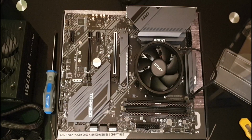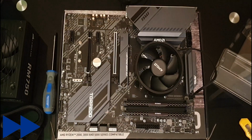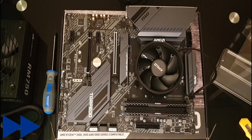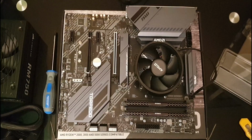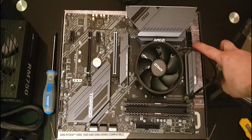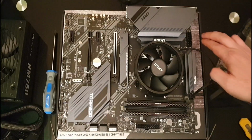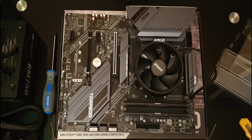We have to get power to the motherboard. So I have a modular power supply for this. So things to remember here. This is your 24-pin motherboard. Here is your 8-pin CPU, and I also have a +4 CPU in this because this motherboard is overclockable. If you have the 8 and the 4, you don't have to fill all 8 and 4. I'm not 100% sure how that goes with my current power supply.